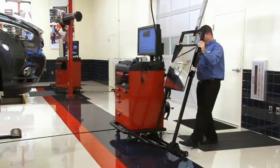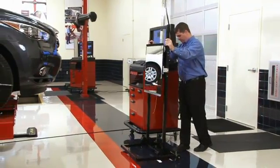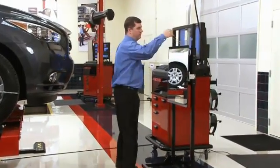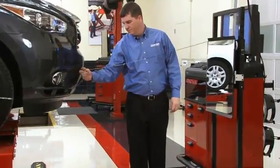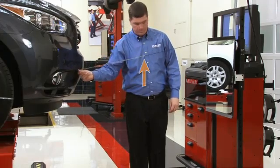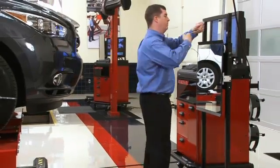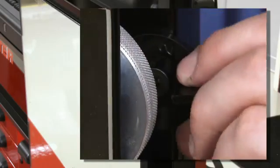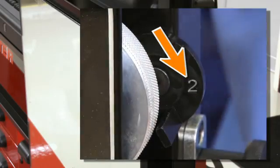To begin the initial setup of the alignment fixture, locate it as shown at the right front corner of the vehicle. To check the distance to the vehicle, extend the gauge chain back to the bumper. Remember, as long as a portion of the gold links contact the fixture, it is within tolerance. Now, set the mirror angle lever to the number two position.